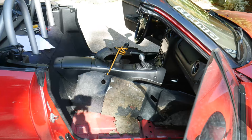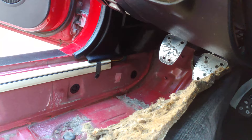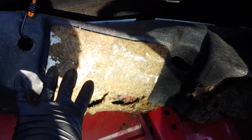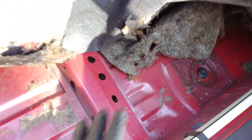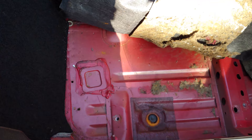The carpet's been moved out of the way on both sides. On the driver side I had to remove the dead pedal to the left of the clutch to get the carpet clear. Because of water intrusion over the years, the jute padding underneath had sort of stuck to the floor and I had to carefully peel it up. The frame rails run along this section so it's just about out of the way enough. I'm not too worried about damaging the carpet since I have floor mats over the front sections, and it may be time soon for new carpet and jute padding anyway.